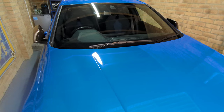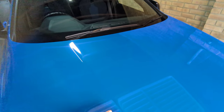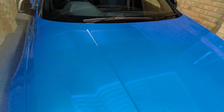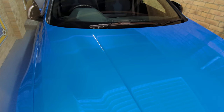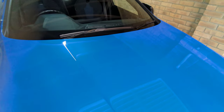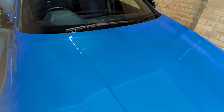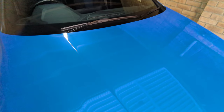So you can do that, so make sure it's all done. The other stage I'd recommend, you need to evaluate the surface of your car. Obviously mine is smooth to touch because it's been clay barred already, but I'll put a link in the description below for a clay bar kit to get. I'll do a video at some point showing this, but I haven't created one just yet. Basically just spray on the detailing spray, get your clay bar and do it in sections, and then you'll feel if it's smooth.